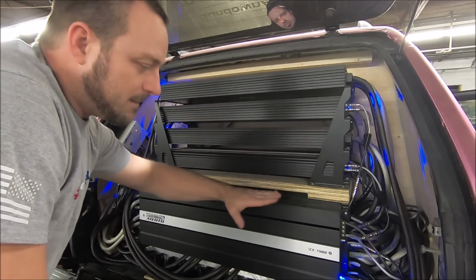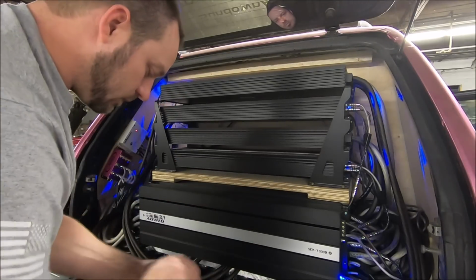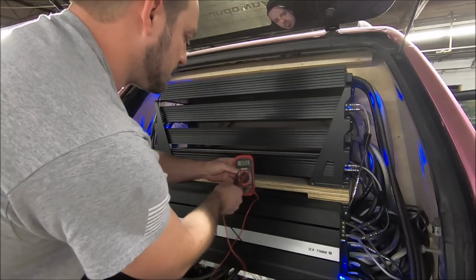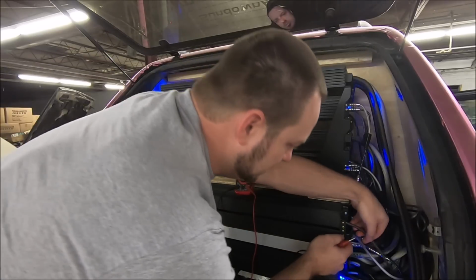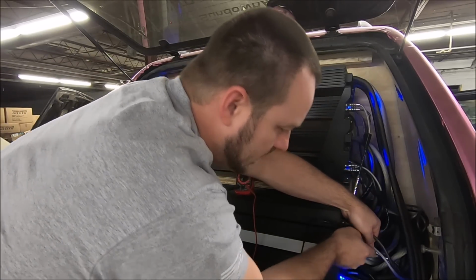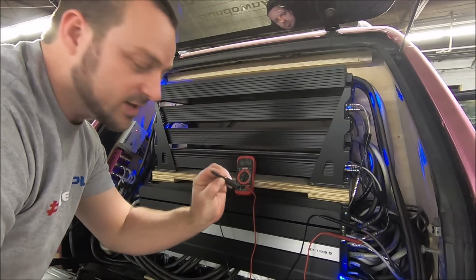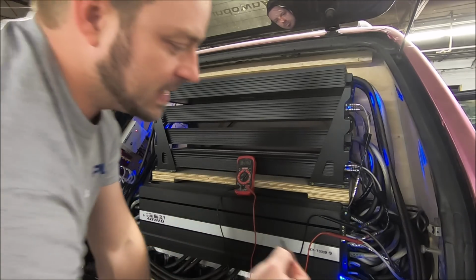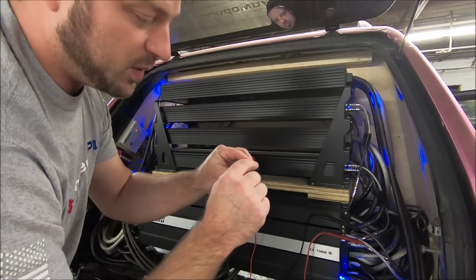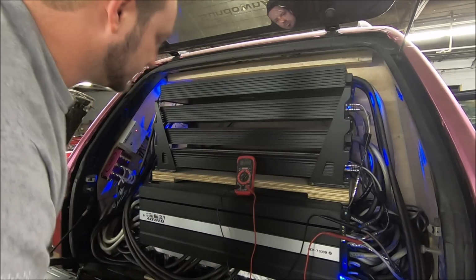So what I'm gonna do is take my amplifier that's reading a little higher, it's reading 3.1, and I'm simply gonna dial it back. So to set up for this, I'm gonna stab my wires so I don't have to sit here and hold it. So I can just leave the leads connected. I'm gonna turn my volume back up. And then I've got my handy little loud tool. You can get these at DVS Designs. They're real handy for sliding in and adjusting crossover settings, gains, things like that. They are perfectly 3D printed to fit in there exact. They're really, really cool to have.